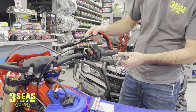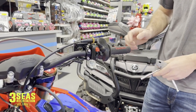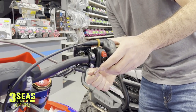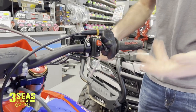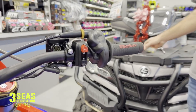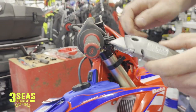On the wraparound bars, the whole goal is for this to go in the end of the handlebar. On pretty much all bikes, first we have to cut the grip but we also cut the throttle tube because the throttle tube wraps around the bar a little bit. I like to pull the throttle tube away from the bike so I can get in here and cut this neatly. On the back side there are two 8mm bolts — just loosen the lower one, slide the throttle tube out far enough to get a blade width in there, then tighten it back down on the handlebar so it doesn't slip around.